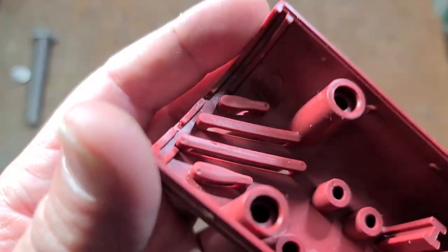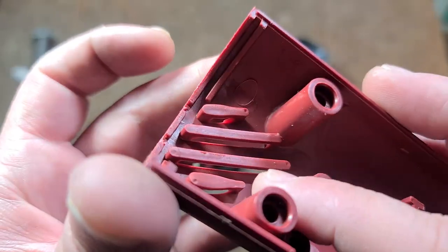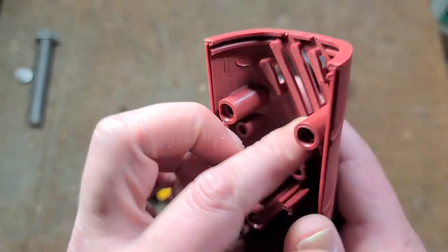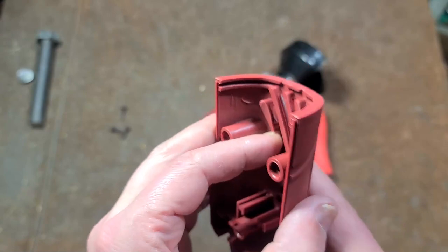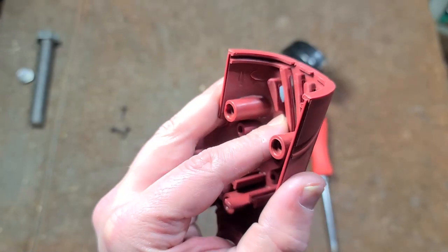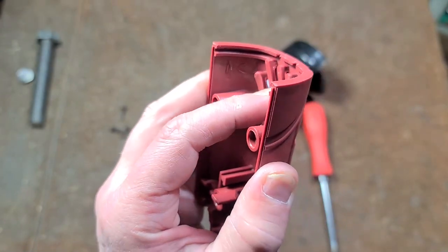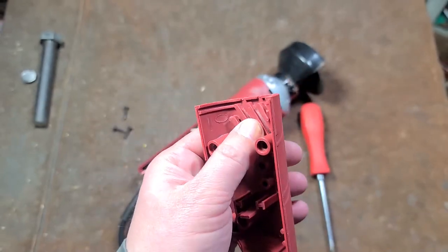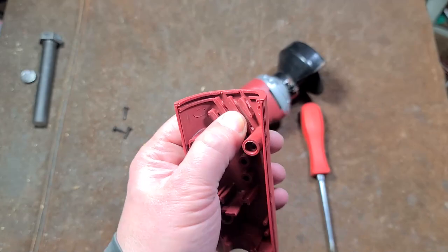The plastic is pretty cheesy. You can see the baffles here — they do have gaps in them to let air through. But the air kind of has to come through, hits this, and comes off the side. That does add to restriction. And these little baffles don't really do anything for the rigidity of the housing, so I think I am going to just cut these out of here.